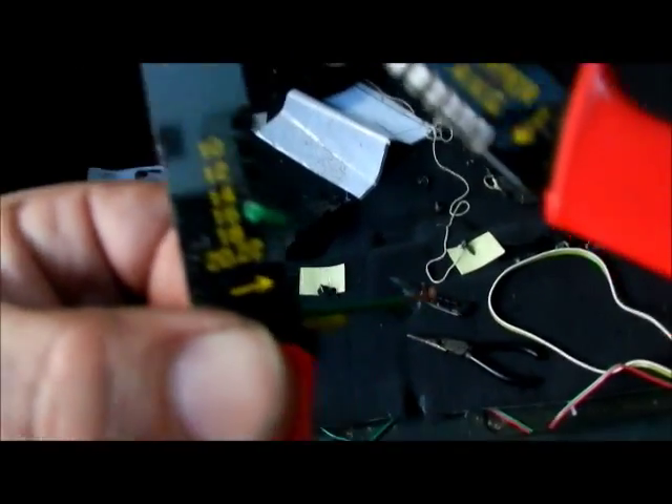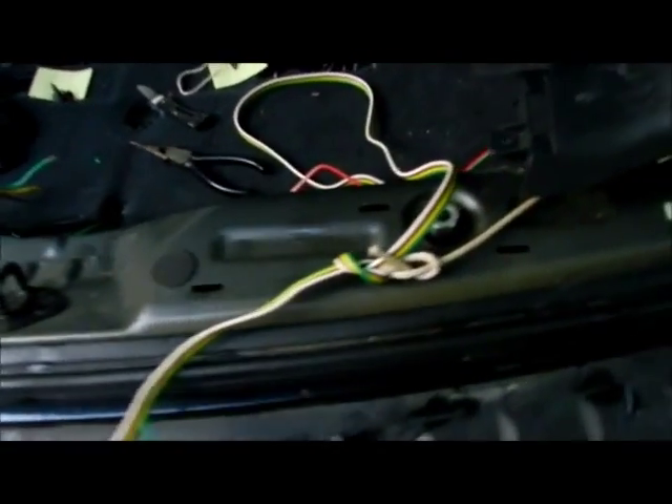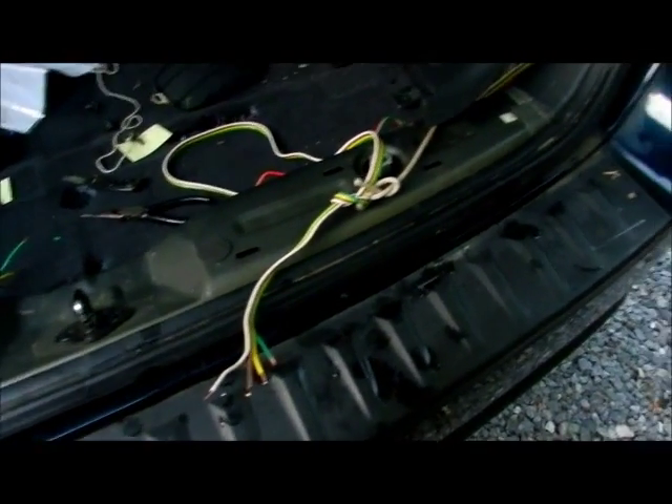Using about 16 gauge on your wire strippers, go ahead and strip the insulation off of the wire. Now that the wire stripping has been done, I can pull this harness back down through that small hole underneath. We're going to splice outside somewhere because we have to use a heat source, and guess what's in the middle of your vehicle - the gas tank - so you don't want to be that close during the heating. That's a splice right there and then there's heat shrink. Make sure you put the heat shrink on the wire first before you splice both ends. Then use a heat source - a hot air gun; I don't like to use matches or lighters. Do one at a time. The staggering is going to make it a lot easier as far as bundling it up - it won't be one big bulk.